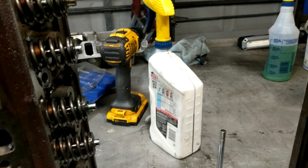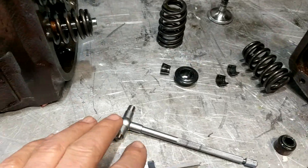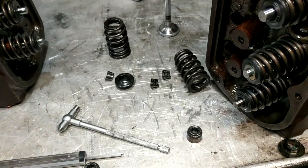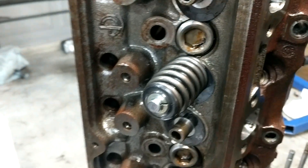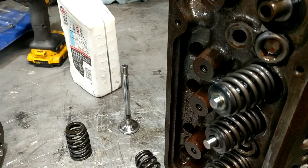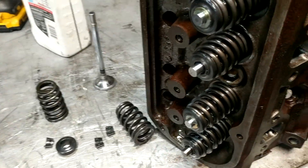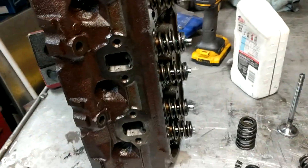I had a similar issue with some Explorer heads - they were not a matched pair. I went to do the valve guide height using a snap gauge and a caliper, and I noticed one head had deeper pockets where the valve spring sits than the other one. So I had to go get a machine to match them. Just paying attention to little stuff keeps you from getting bitten in the butt. That's all - later.